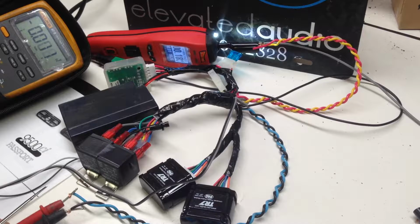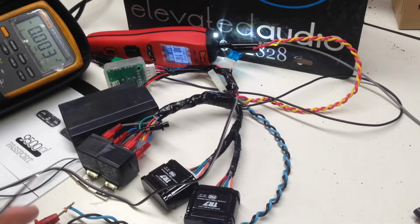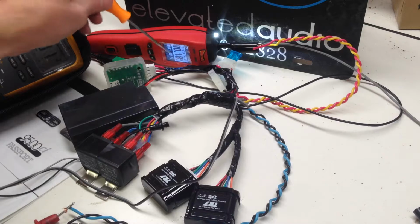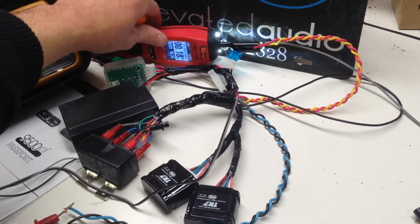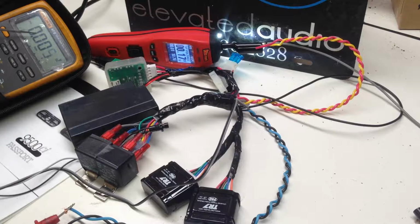These wires right here are simulating the output to the 9500ci. We have the input from the car right here, the accessory. The power probe here is doing that. And this is actually a great video because I'm only getting almost 10.5 volts out of my test bench here, as you can see right there on the display. Here we haven't started it up, so no voltage out.